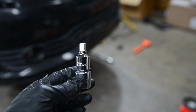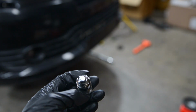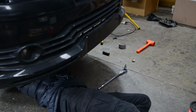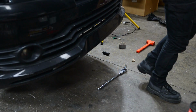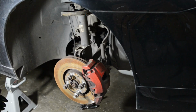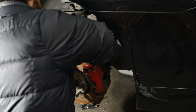So now we have the correct tool to appease the croissant making people of France. Time to drain the gearbox oil. Well, no metal shavings in the oil, so that's a good sign. Now that the gearbox is drained, I should be able to pull the axle out.